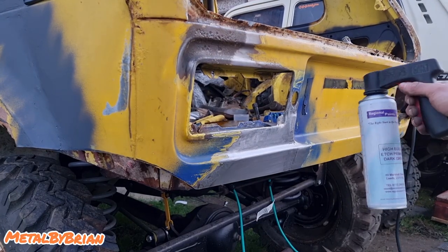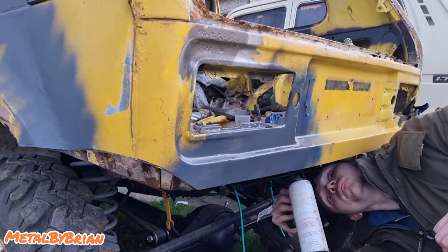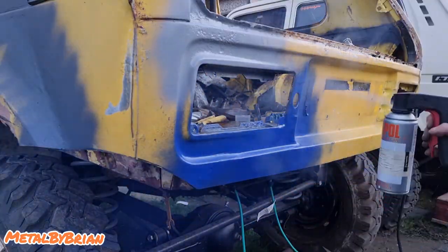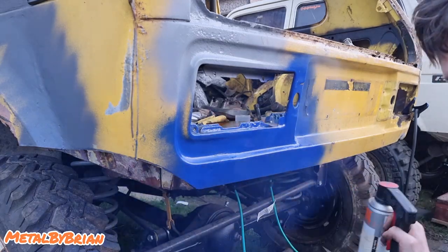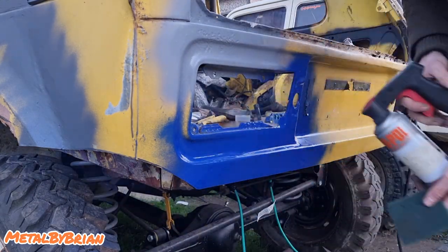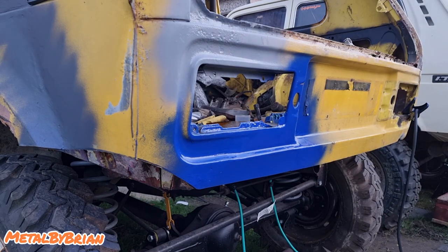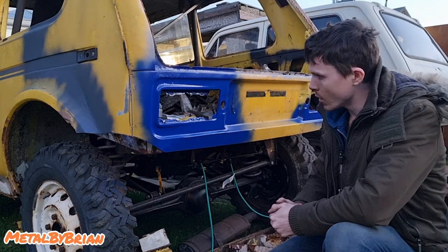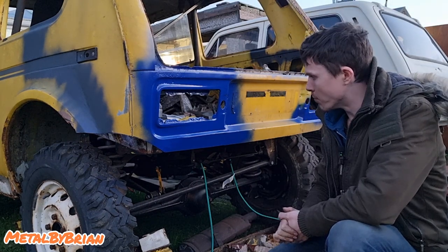And then it was time to lash some primer on, two different cans if you notice, the shades are different, and then some top coat on top of that. Never just lash your primer on, you should always use a top coat as well, because primers are actually hygroscopic. Not a lot of people realise that, they absorb moisture out of the air, most primers are anyway. Right, that's it done, I'm very happy with it. I don't even think it's going to need any body filler,